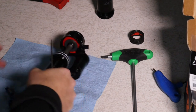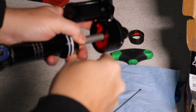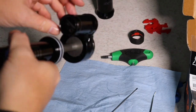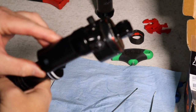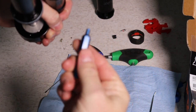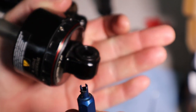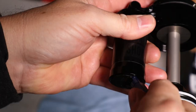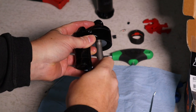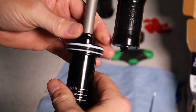While we're here, I'm going to go ahead and remove these spacers — we definitely have three spacers there. Now I'm going to unscrew and release the air out of the piggyback as well. With a valve core remover, I can remove the valve core. These can either be charged with nitrogen or air. There's our valve core — now I'm going to proceed to remove the piggyback and get that piston out.